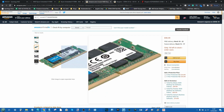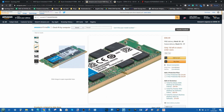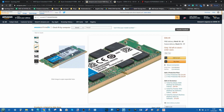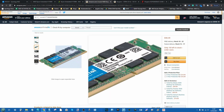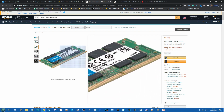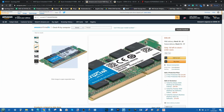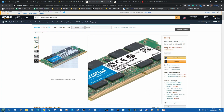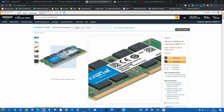The reason being is you have to make sure that each of the cells on that board, one by one, make sure each and every single one of them is not too big that the system can't deal with them. A lot of CPUs, more the enterprise ones, slightly less so, but certainly ones like this Ryzen or maybe some of the Celerons require, for example, in this case, each one of those cells to be 1 gig in architecture each, and dual rank means on either side there'll be another one. So 1, 2, 3, 4, 5, 6, 7, 8, and another 8 on the other side. If it was single rank, you generally find fewer chips, larger capacities, and that's where the CPU can struggle.